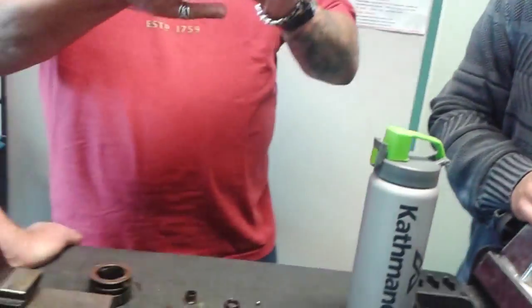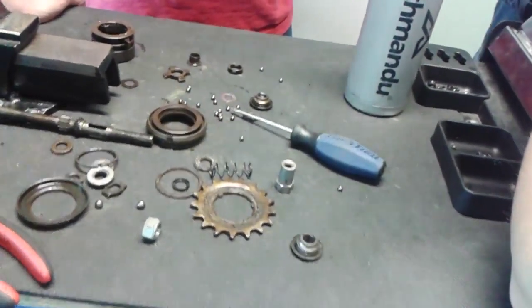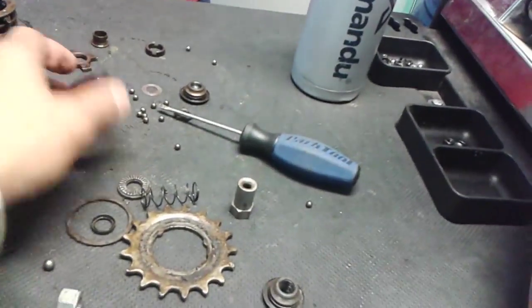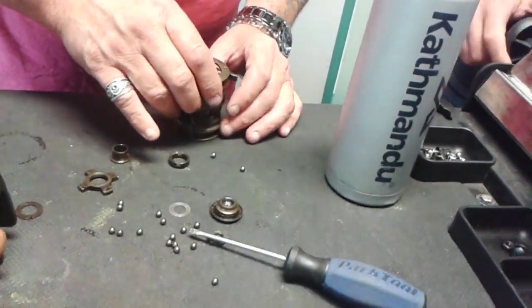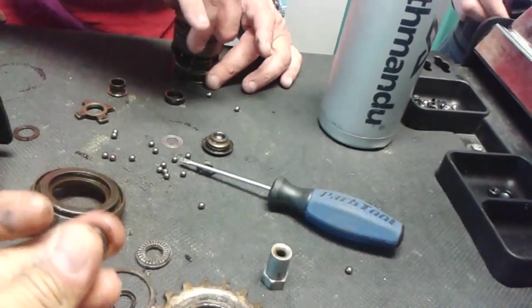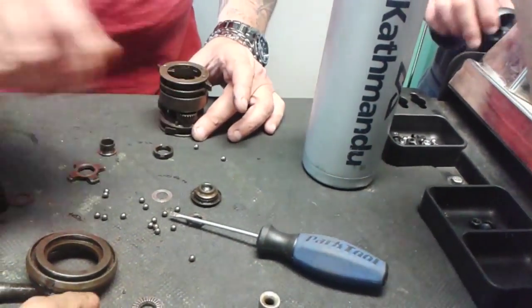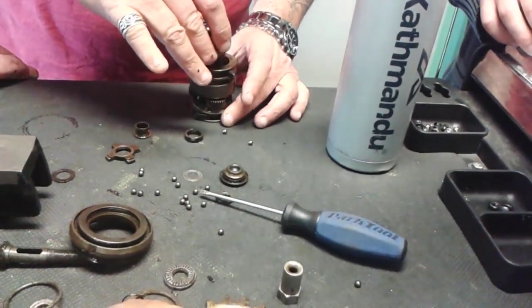Oh, it's marvellous. Kerosene's got oil in it as well. You don't use petrol because it's a pure petroleum distillate, and it just strips all the lubrication off your parts, which you don't want, particularly if you're cleaning chains. But if you clean it in diesel or kerosene, it's sweet. That's what the baths are, with a little switch in there. I've seen those in bike shops.